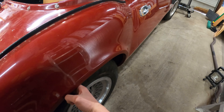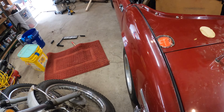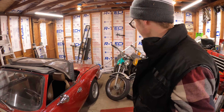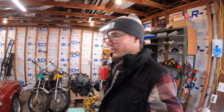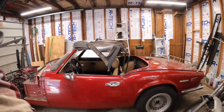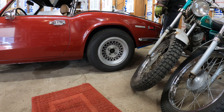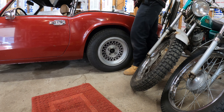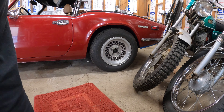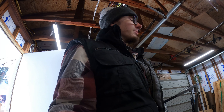This side's a little bit lower, but that is a huge difference. I'll probably measure the camber angle at some point because it might be too much. Let's see if there's much difference in actual height — the other side is 23 inches. That's like six eighths less on one side. Why is one side so much lower? That does not make sense to me. Maybe there's something funky with the leaf spring — maybe I'll order a new one.